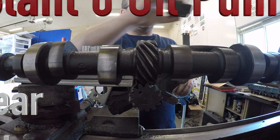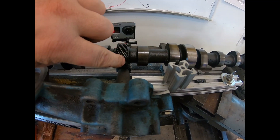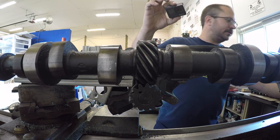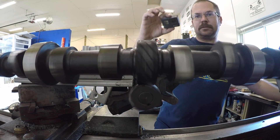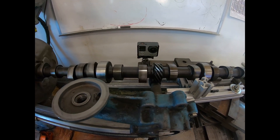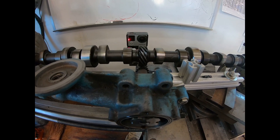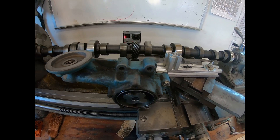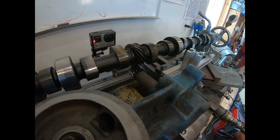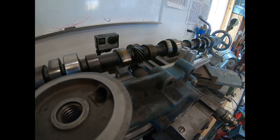I've chucked up in the lathe the 72's cam, which you can see has a big old chunk out of the teeth and that sheared gear. This is the 72's actually running, and what's interesting — because we're in a lathe we can run it out. Now if you got this far out you probably would have a problem. Notice how it's riding right on the edge of that and it kind of changed pitch.